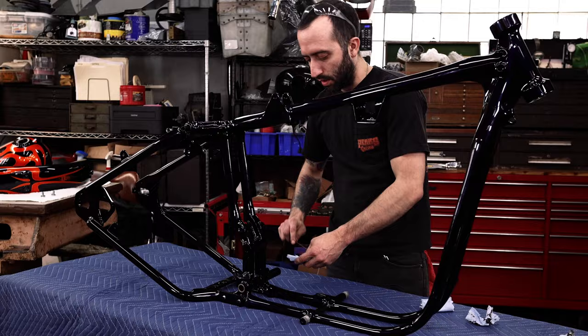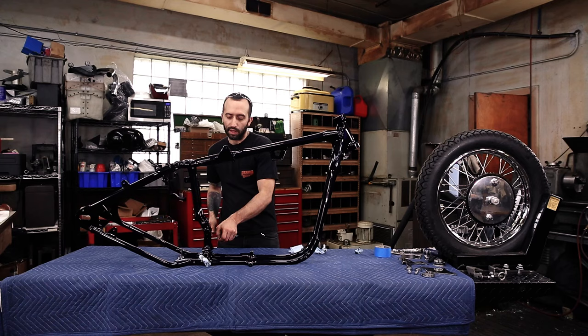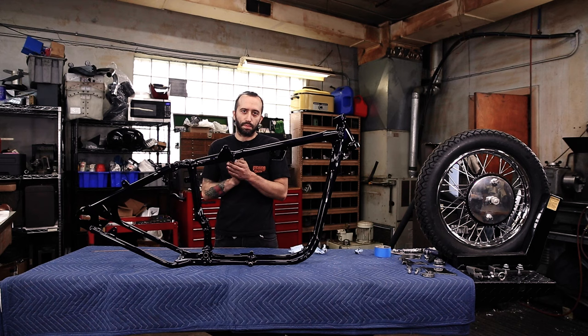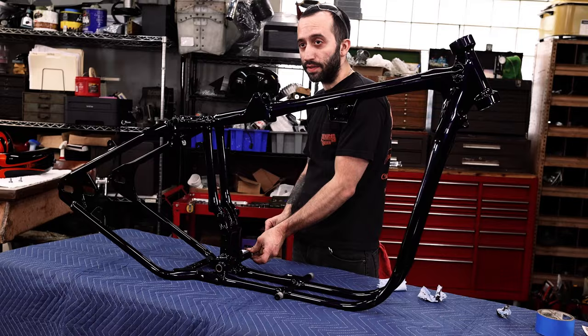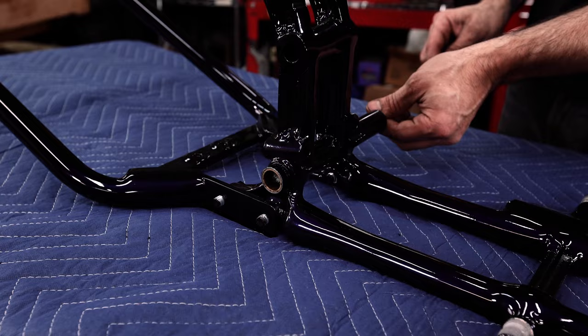And after we get this cleaned out, we're also gonna wanna clean off the paint in a lot of mating surface areas, so that it's metal to metal bolting up and you don't have a layer of paint to smush, and then you're gonna have to re-torque stuff constantly. Get your mating surfaces just right, your hardware will stay tight the longest and you won't have to keep re-torquing things. So this is one more pass through. There we go. I think that'll be okay.